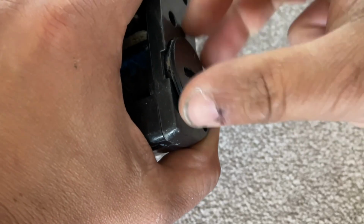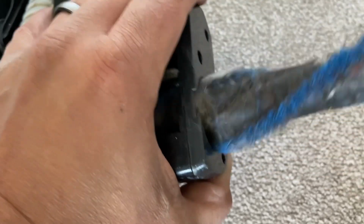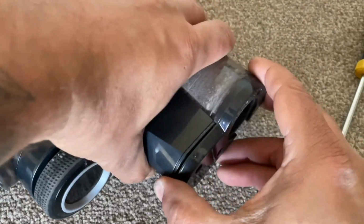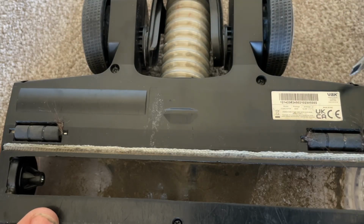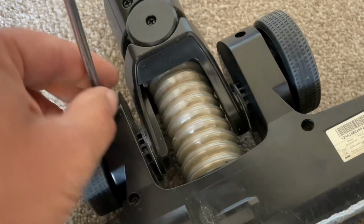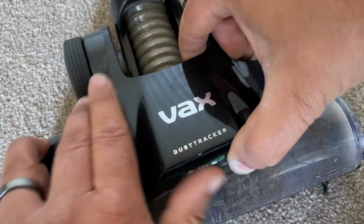You need a crosshead screwdriver, and we're going to start by removing the brush bar, and then each end cap has got 3 screws on it. They're easy to see. You undo those and take each end off. Then underneath, again, really easy to see, there's 4 screws along the back and then 2 screws right at the back. We're going to take them off, and then hidden away from plain sight underneath this front cover, you just need to prise this up.